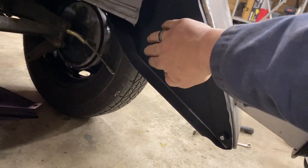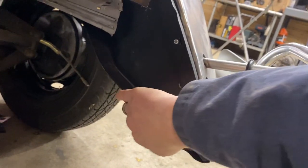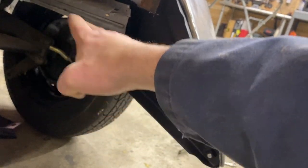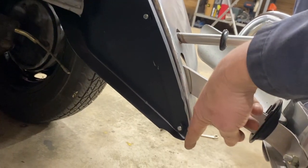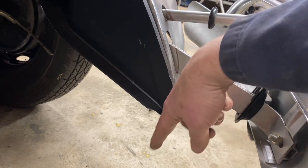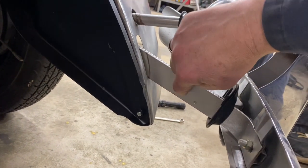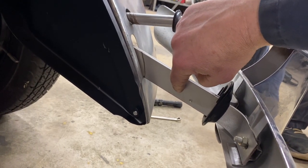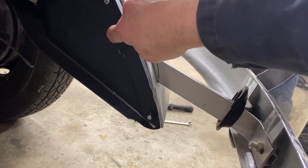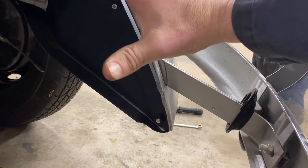All right, so the back of this bumper brace patch needs to match up. So the bottom of this will need to match up with the bottom of the original piece where we're patching it in. We've held the bumper where we think it's supposed to be, and it's 13 inches from here to the floor on both sides. And the two bolts that hold in this bumper bracket we think should be level. So between those 4 points, that should locate this patch piece for us. The left to right will be set by the apron.